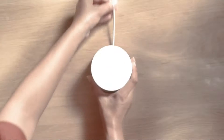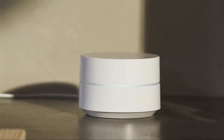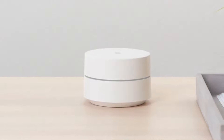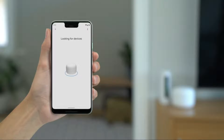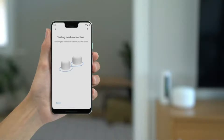Now that you've set up your network, let's connect additional Google Wi-Fi points. Each point you add will provide additional coverage to your home by creating a mesh network. To provide Wi-Fi coverage to every corner of your home, spread your points evenly and no more than two rooms away from each other. Building materials and other objects can interfere with your coverage, so you may need to adjust the location of your Wi-Fi points if you experience issues. Connect your power cable to the next point, plug the adapter into a power outlet, and follow the instructions in the Google Home app. When you finish setting up all of your points, the Home app will run a mesh test to confirm your devices are correctly placed, online, and working together.